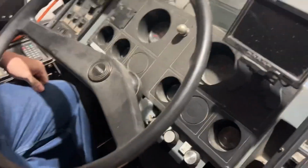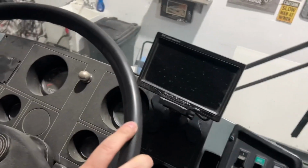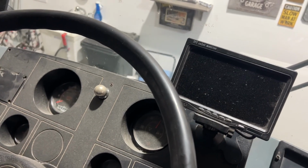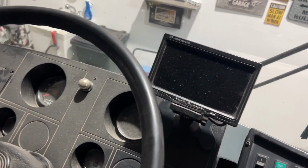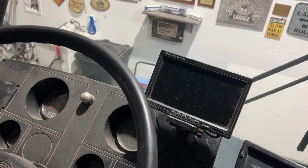Okay, we're just checking for air leaks here and seeing how severe they are. Your air gauge right now, we're reading just under 90. Is that correct? About 87? Yep. And we're going to watch it for about 60 seconds and see how far it comes down. But we know it's not a whole lot of PSI leak because it was 87 at least a minute ago when we checked it. But we want to just confirm that. So that's pretty good.